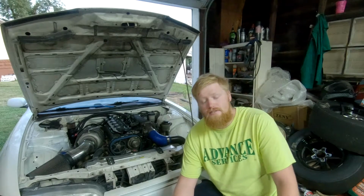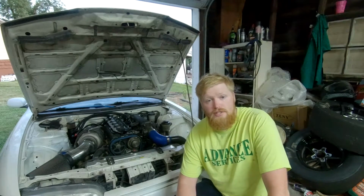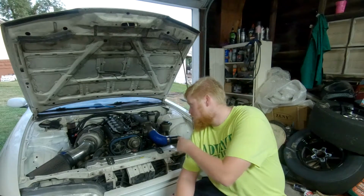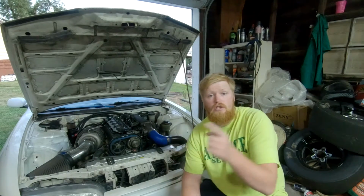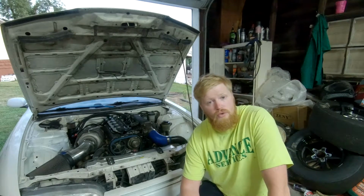It's been fantastic. Number six, you're going to have to get an oil filter sandwich plate, and that replaces the stock oil cooler. This plate has multiple oil ports on it that you can put fittings in, and you can put oil pressure sensors and turbo feed lines. I actually have my VVTi solenoid going to it, because the non-VVTi bottom ends do not have ports for the VVTi.